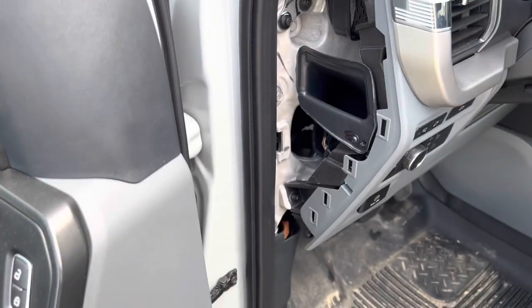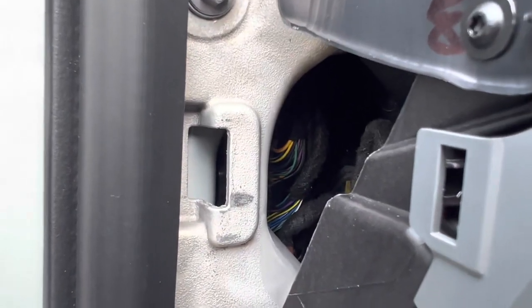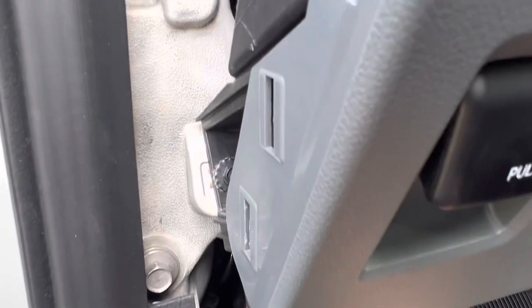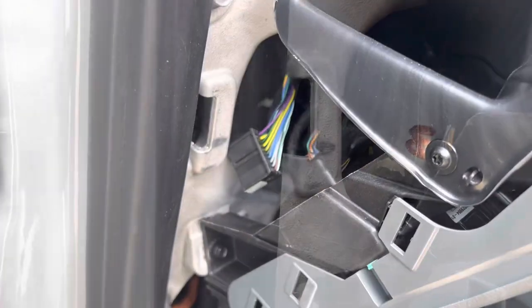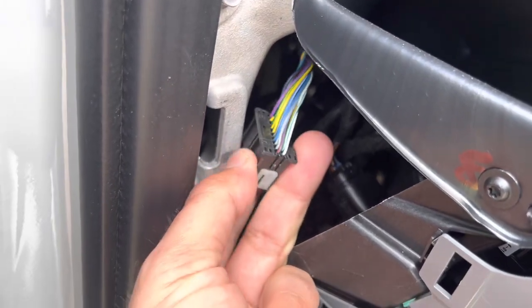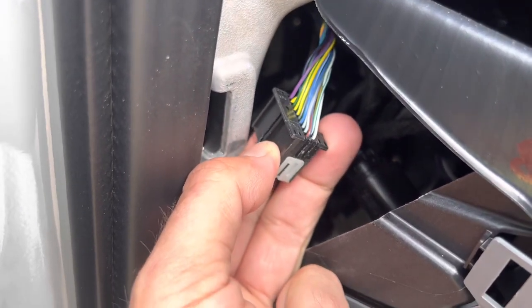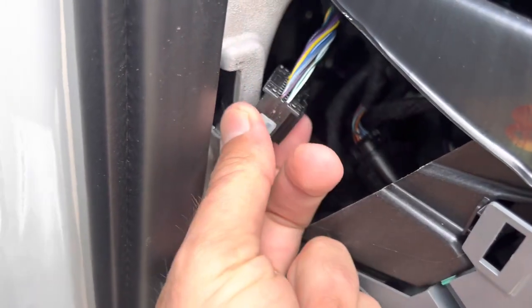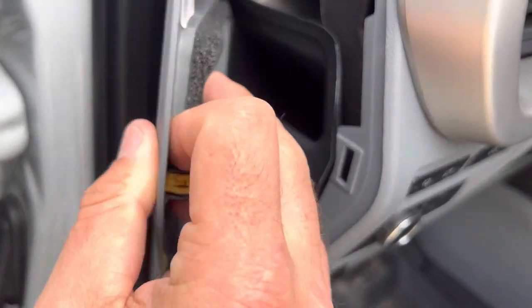The wiring is going to be behind here — we'll go underneath, unhook it, and pull it through. Looking in this hole right here, there are basically two harnesses. There's one up top and one on the bottom. There's a tab on the right side — pull that and work this thing out. Here's the plug — we're just checking the wires at this point. I believe it's these bottom four on the left. If you have those wires, you can check this off. If you don't, you cannot proceed unfortunately. Check those wires, plug this back in, and I'll move on the other side and check that one as well. Plug it in until you hear a pop, then we can put this panel back on.